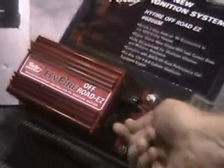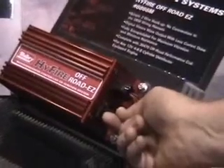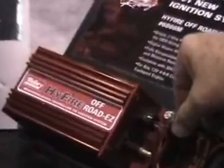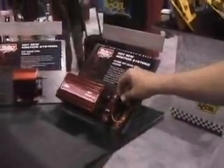That takes care of using the stock coil to turn on the computer, or turn on the CD, and at the same time trigger it. This connector plugs into the coil. This two-wire harness here just goes to the battery — that's all it takes to install it. It totally eliminates the necessity for cutting and splicing or plugging adapter harnesses into the factory wiring.